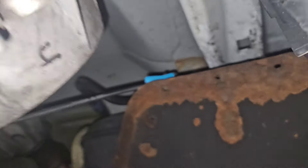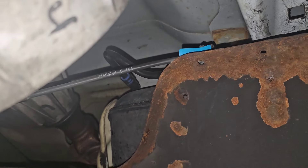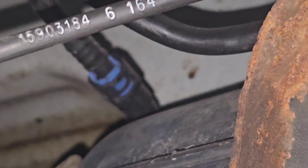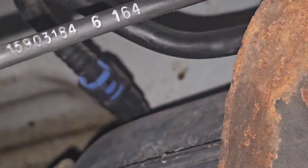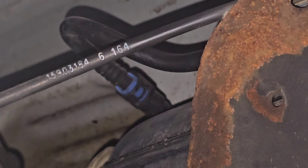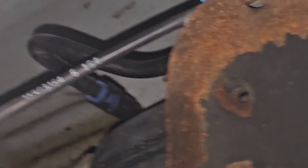What I found was there was an EVAP line right here by the fuel tank — one of these lines right here that go across the fuel tank. You can see the connection right there with the little J-hook. That connection with the blue was actually pushed out, and I might have done that when I installed the new fuel pump and the new lock ring and washer. So I put that back in and at that point there was no more check engine light.